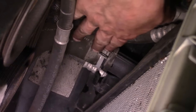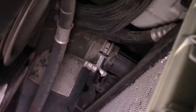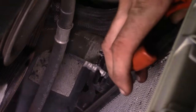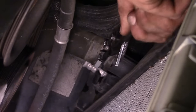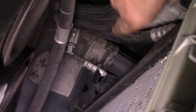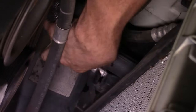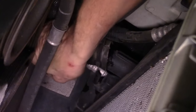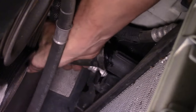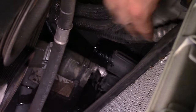Now we'll move on to that lower radiator hose — that'll be the last hose we need to take loose from the radiator assembly itself. Use your spring-loaded tool, get down on here and squeeze. Then we can work on getting it out of the way. We can try to grab it by hand and start wiggling it off. We still have our catch pan underneath because you can always have some residual antifreeze in the system. And there we go — we've got that one off. Lower hose is off and it's draining into the catch pan.